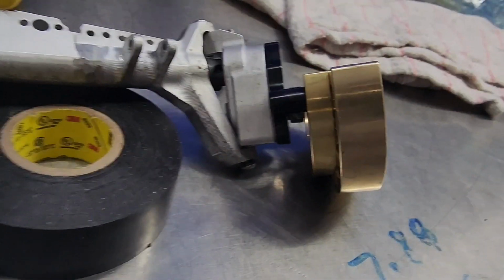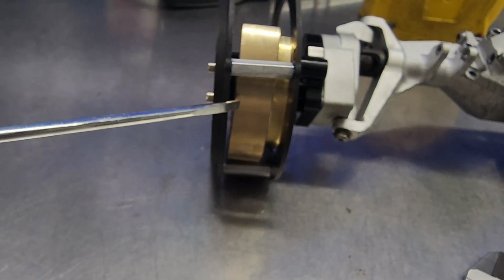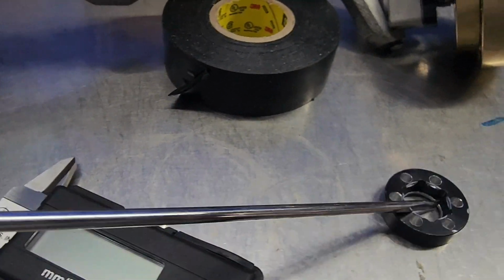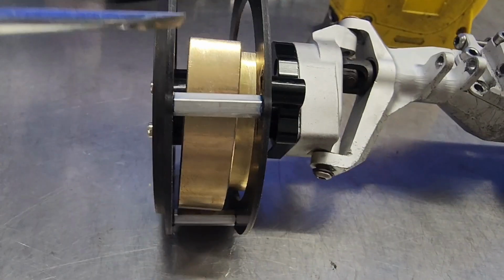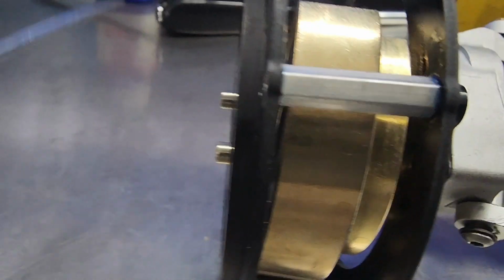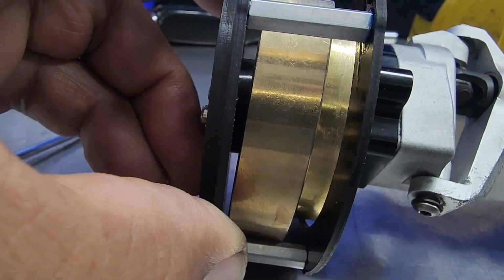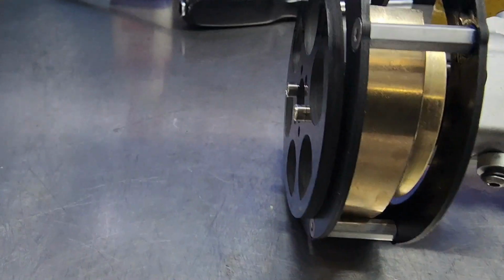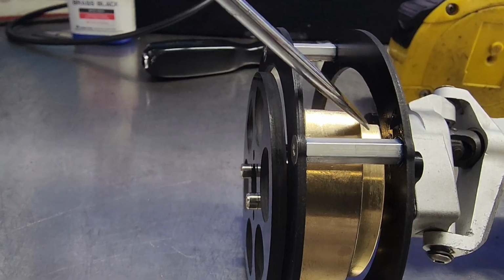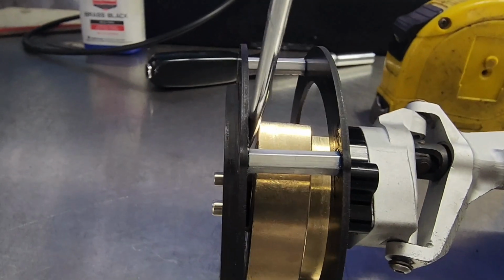Now, it just seems kind of weird that they suggest using a 28mm hex to keep the front of the wheel out right here, but that wasn't enough. I had to make another 6mm spacer to put behind my 28mm hex, just so that we could get clearance right here in the front of the wheel, because that's where it rides. I mean, it could go a little more, but I don't want to stretch it out too much farther. You've got all of this space right in here, and the front there's maybe 3 or 4 millimeters, just so the front doesn't hit.